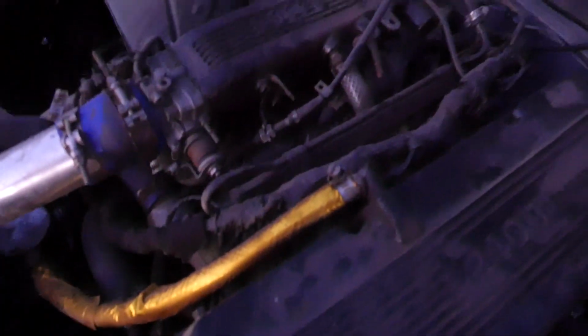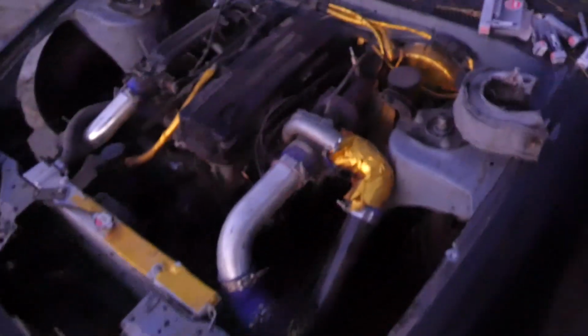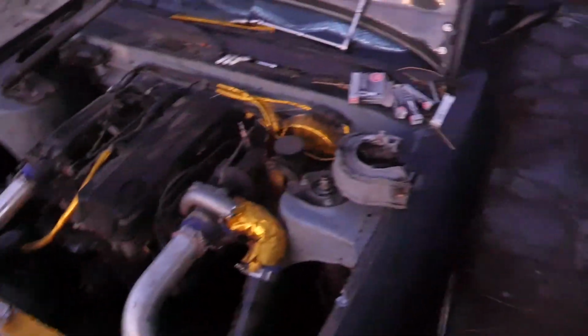But while I have to take off my turbo blanket, noting so, it was all black inside. So I am having a gas or a turbine leak as far as here. It's not affecting my boost because I am on an external wastegate, but nevertheless, I don't want any leaks. So I'll just be removing my downpipe later and then getting a new gasket on there. But all my lines and all the wiring are good. This will probably be the last drift event on this setup, and then me and Terry will be changing a lot of things over.